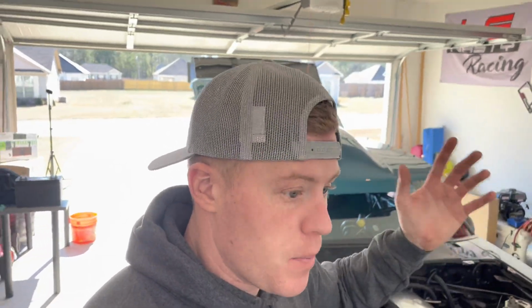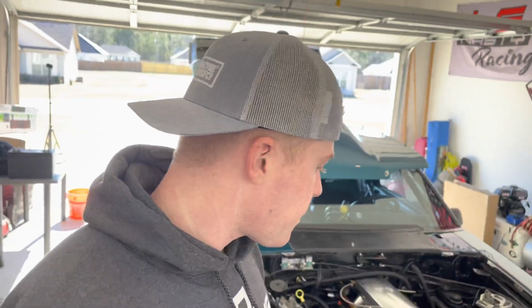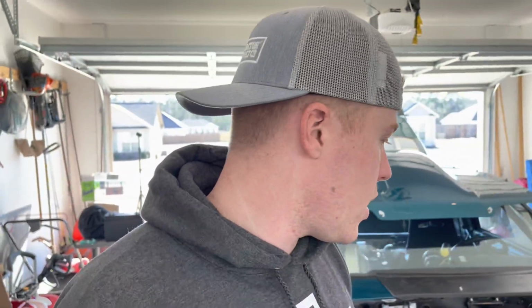So if you're like me, you want to try some things. And this is a good idea through a friend of mine. He said, hey, originally I was going to move the intercooler that's currently mounted flat in the car up in front of the bumper and just force air down as I go down the road and down the track. But instead, why not order some Amazon fans, put some on there and run them into a switch, and just keep it on a switch so when you're going to make a pass or when it's hot outside, you just hit the switch on and it's going to cool. Probably just leave it on, honestly. It's going to cool your air down. So for you air-to-air guys, this is kind of what you would want to consider if you don't want to go the expensive route and do methanol injection or other things like that.